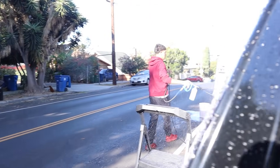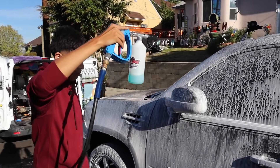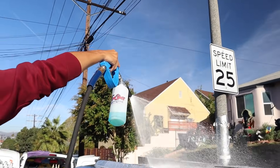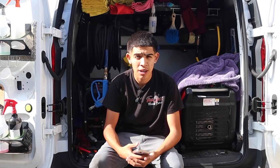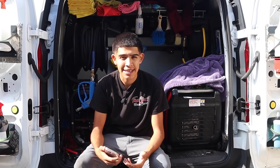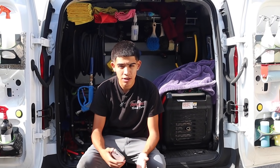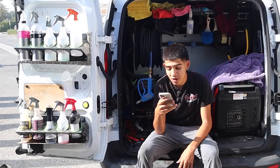The first question is from Louis4: how do you wash a vehicle that's been full of dirt and grime for a long time? Depending on the condition, I like to pre-soak and pre-rinse the vehicle first, then foam it with a stronger soap — I use Koch Chemie Pol Star or Koch Chemie Green Star, about one to two ounces mixed with regular soap. Let it sit a couple minutes, rinse, repeat one to two times, then follow up with your final foam and hand wash.